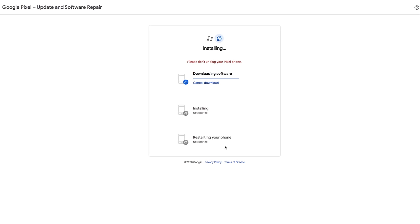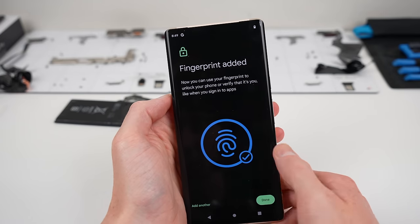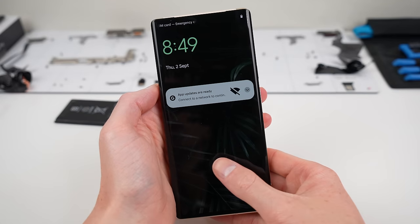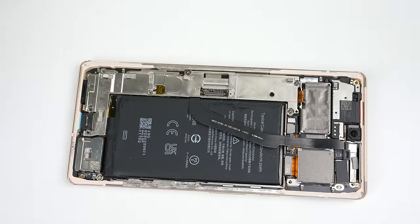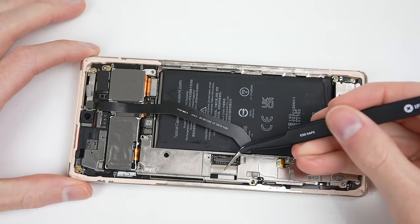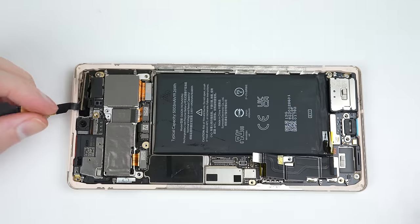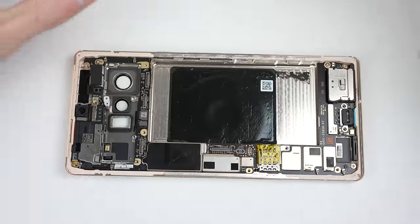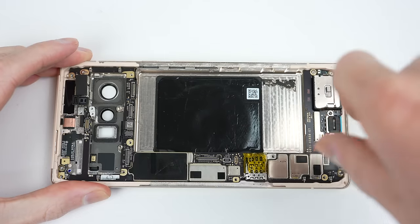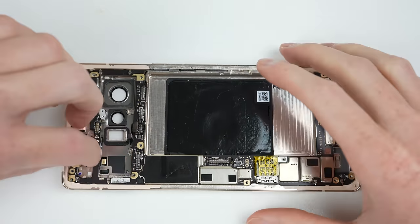After about three seconds, the phone reboots into Android. I had to complete the process twice as it didn't work the first time. It appears to complete the calibration on boot rather than requiring separate software. After it successfully completes, the fingerprint works again just as expected. Now that we've confirmed the Pixel 6 can continue to work without issue after swapping all of its components, we can reassemble the two phones. Google has proven that other companies are needlessly locking us out of repairing our own goods. While the fingerprint sensor needs calibration after replacement, Google has provided the tool publicly on day one — meaning whether you send it to Google, a third-party shop, or do it yourself, you have access to the tool.